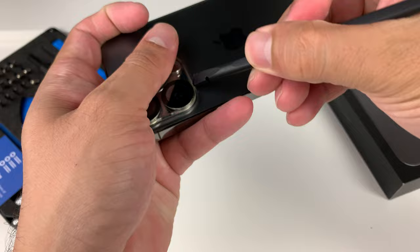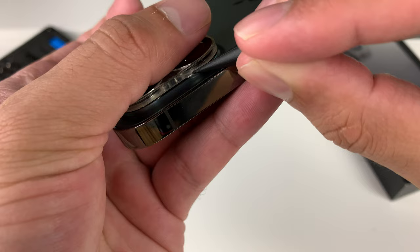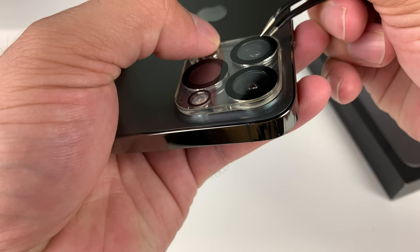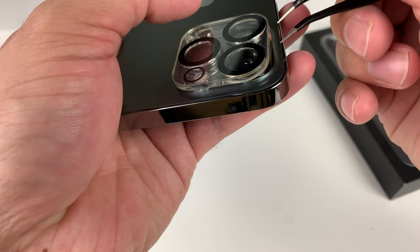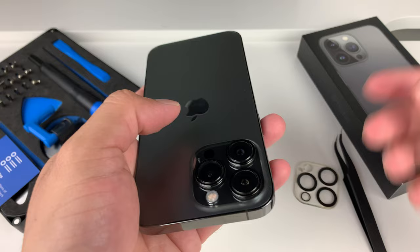You're going to try multiple times — just try to get underneath as much as possible. You can see there's a little bit of a crack here and it's pulling apart. Go all around just like that, and then lastly we're going to use the tweezer. You can see we're able to put the tweezer in and the lens is popping up. We just pull it apart and just like that the lens comes out. We heated it before to make it softer, so you may have to keep repeating the process.